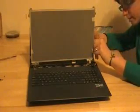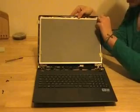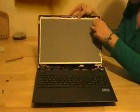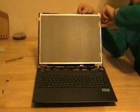It's now time to reconnect the cable connector. Here's the cable, little piece of tape, and the connector on the back. I'm just going to slide it in and put the tape back down. But I don't think the tape's very sticky anymore. I might do something else for that. Okay, so the cable slides in from flat, that is, don't come from above, go slide along the bottom and slide in. Very gentle fit. The tape did actually stick again.